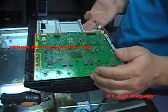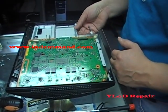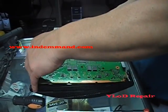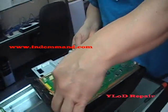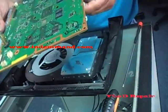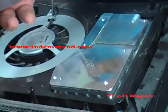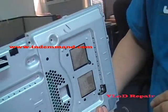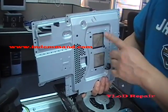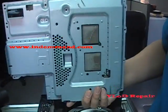Lift the whole thing, including the heat sink or the metal portion of the board, and lift up and away. This will expose the board. Now you see here are the two heat sinks, here are the video chips which we will reflow — do a reflow on them — and put them back in.